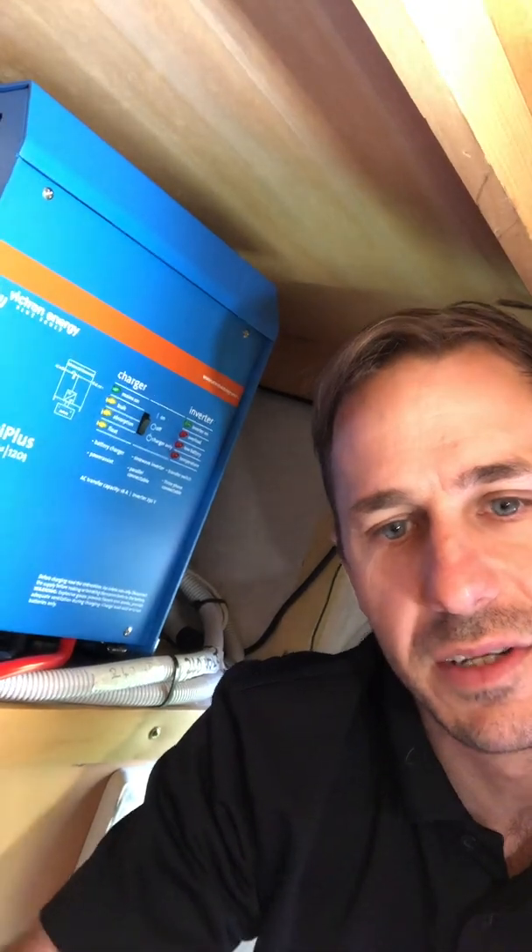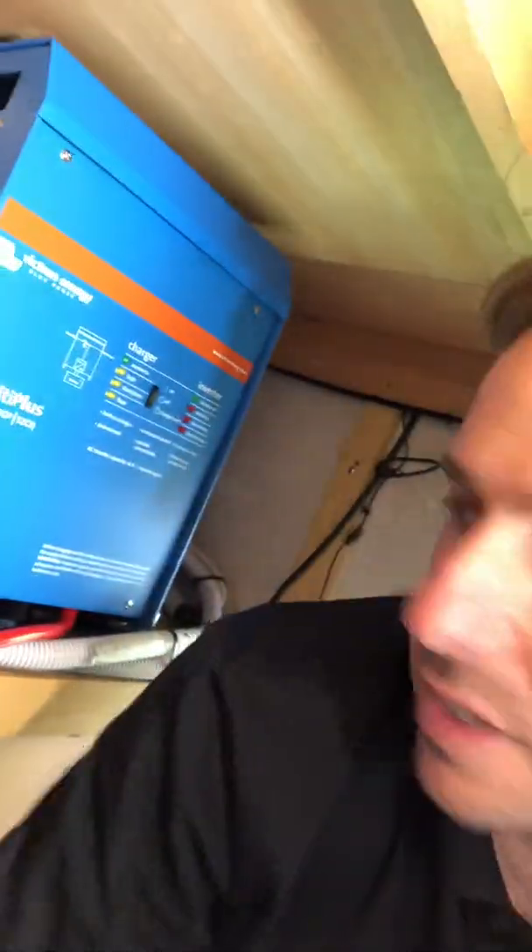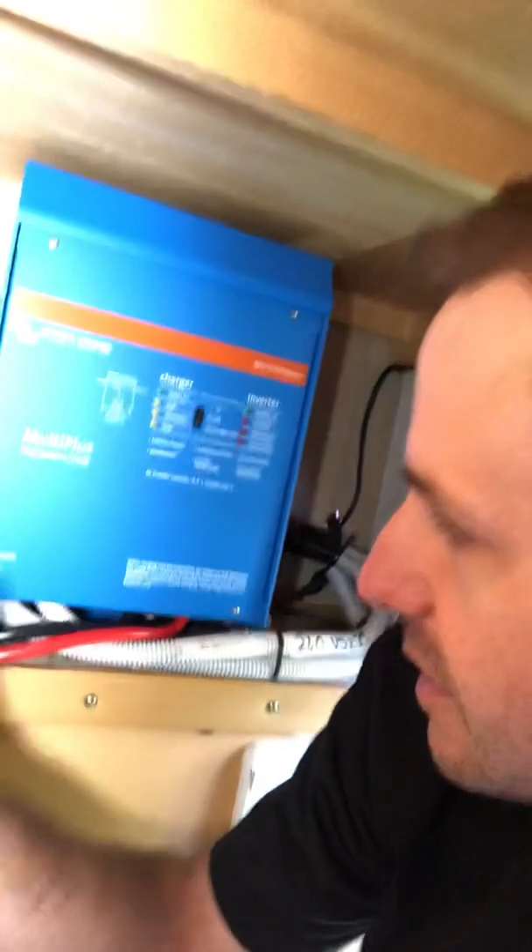Now, I haven't read the book — it says it right there in plain black and white: 50mm² cable, up to three meters, by two. That's not a black and a red — that's two blacks, two reds, all the way from this. If not, you go up in cable size — you go up to 70mm². They haven't done it.